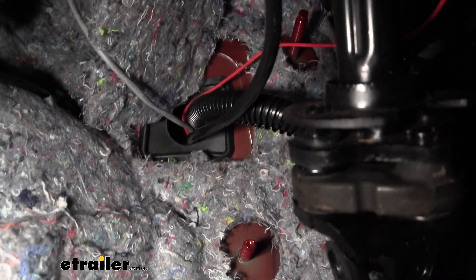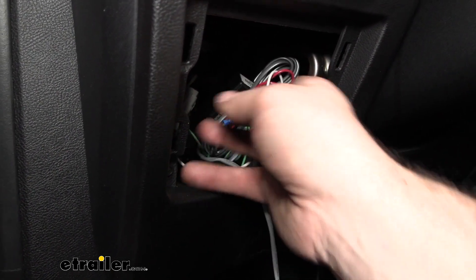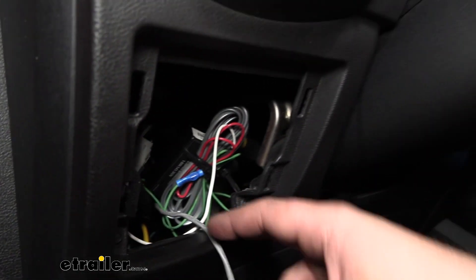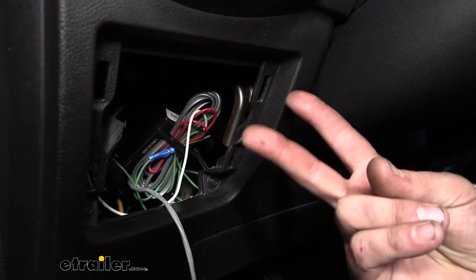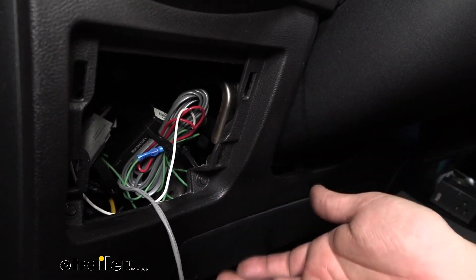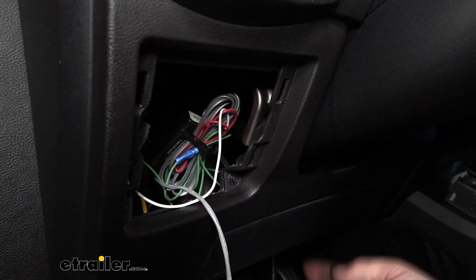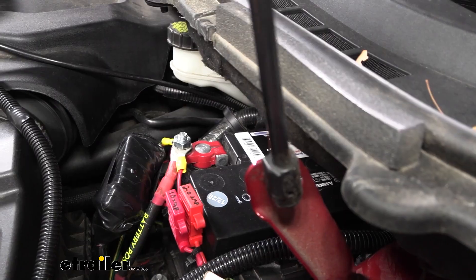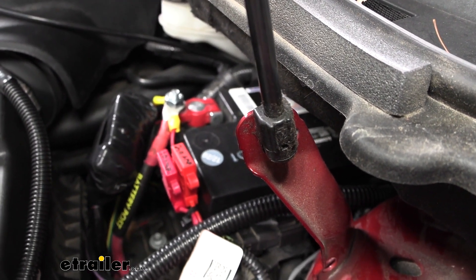Under the dash, additional wiring includes the stoplight switch and wireless coach link. The wireless coach link has two wires: a white wire with a ring terminal grounded to the chassis, and a red wire that attaches to the green wire from the stoplight switch. The stoplight switch comes with a green and red wire — the green goes to the wireless coach link, and the red wire is extended into the engine bay through the grommet to a 10 amp fuse holder connected to 12-volt power. Again, don't put the fuse in until everything is hooked up.